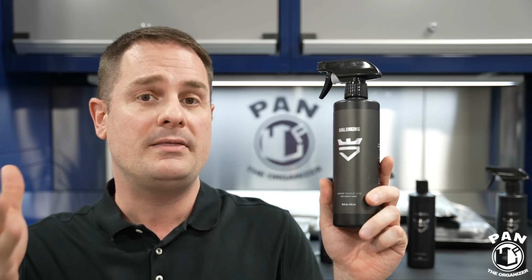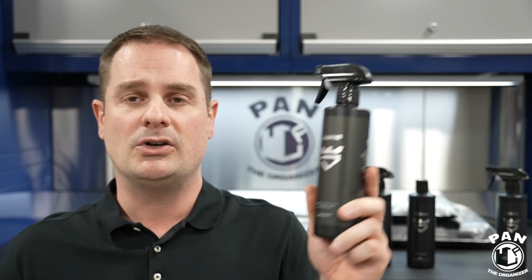But the purpose of this one is to answer all of you guys who had specific issues with traditional coatings. Maybe the price was too high, or the time it takes to apply, or the experience level, perhaps you're not ready to dive into coatings right now because you're a bit too scared of rainbowing, flashing, and all that kind of stuff. You don't have the 48 hours of curing time needed for the ceramic coating without exposing the vehicle to the elements, or basically just wanted something super fast to apply. Well, this is it. If your car has no protection, you can use this and you're going to get up to 3 months. So see this as a coating light, right? In a spray form, you spray on, you buff off, and that's it, you're good to go.